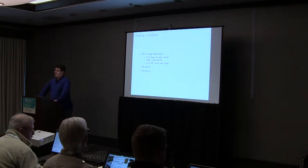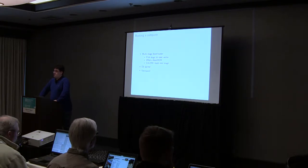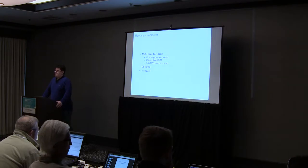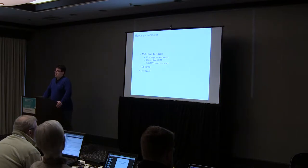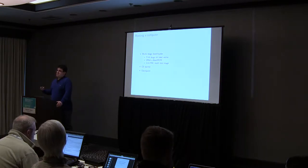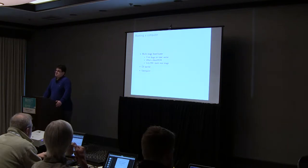First of all, let's talk about what a bootloader is. When you turn on a contemporary computer, there has to be some code which gets executed after the CPU completes its power sequencing. That's usually the bootloader, and its task is to initialize the hardware, load the next stage, and start it. It used to be that when the CPU started executing from the reset vector, there was some user-replaceable code at that point — typically U-Boot or something else.